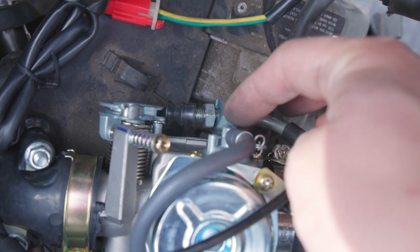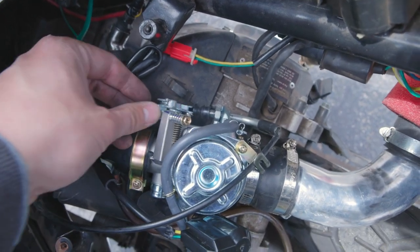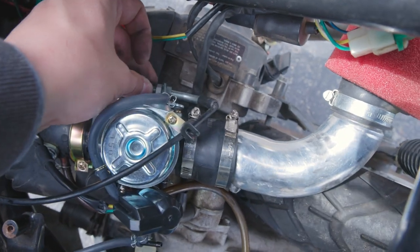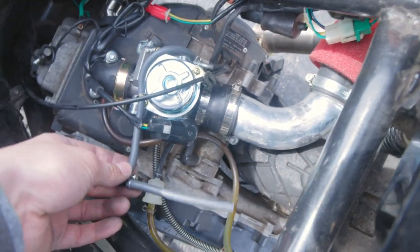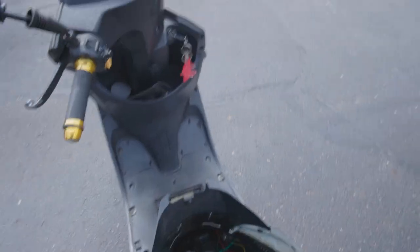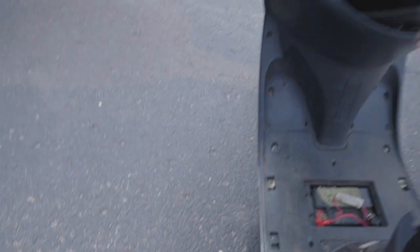Six military helicopters just went by — we get them every once in a while, it's always kind of creepy. I had to do a couple of things here: you can see the throttle bracket — I had to unscrew one of the bolts and flip it upside down, because the way it wanted to mount would have had the throttle open partway. I flipped it upside down and it's working fine. I don't think we're going to need to hook up the vacuum line, but we're going to find out. Everything's connected, so let's give it a shot.